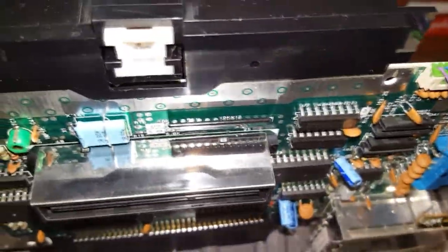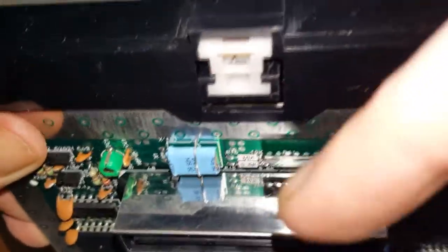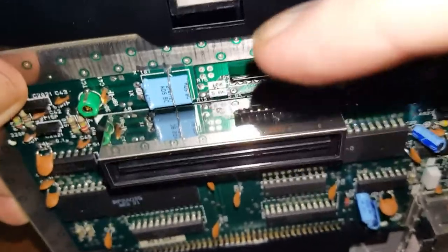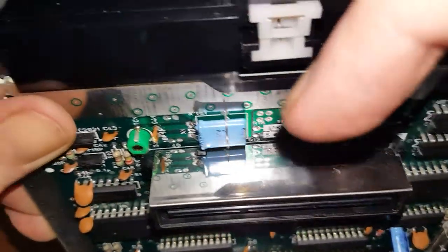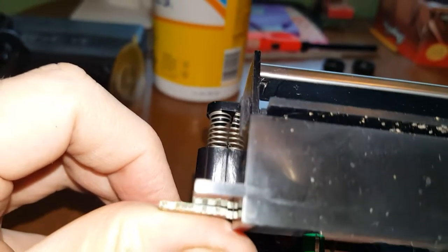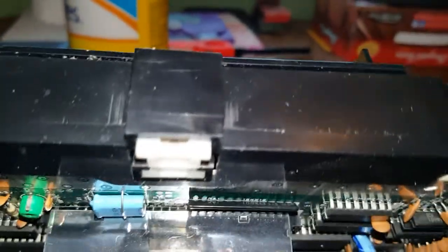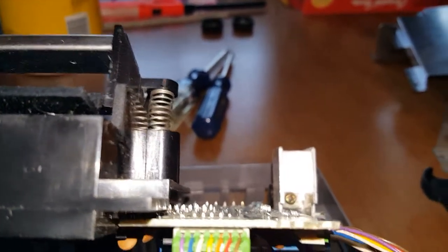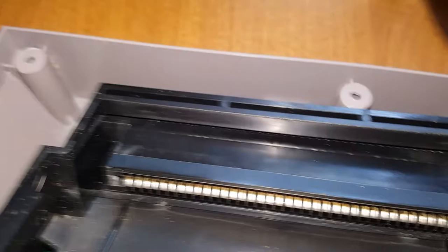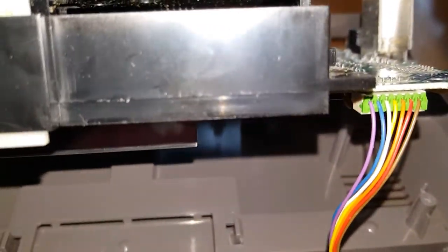The tricky part — if you look underneath the board — is that there's a lip. See the black lip that comes down off of the tray: it's got to tuck under the motherboard. The black tray sits on top of the board, that black lip is under the board, and the black edge here is back on top. You've basically got to sneak the tray on top of this part in the back while simultaneously getting it underneath the edge in the front.